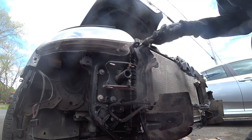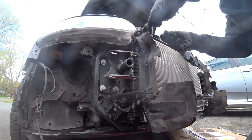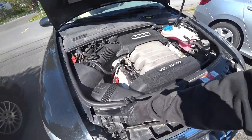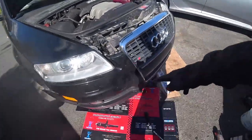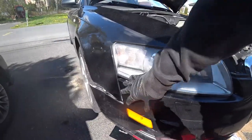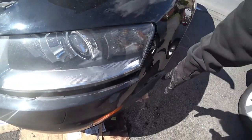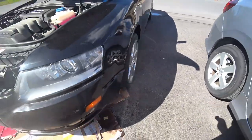It goes over it — see, it goes over it. So the way I put back the bumper: don't forget to put back the intake shroud, there's a small filter right here. What I did was hook up the fog light first at the bottom, then raised it, and as I went up I connected the connector for the corner lights. There was one connector right here — actually in total there are two: a fog light and the connector for the corner lights. I still have to connect back the headlight washers before putting this back. You have to align this metal bolt right here with the fender, then put back the screws and it should be okay.